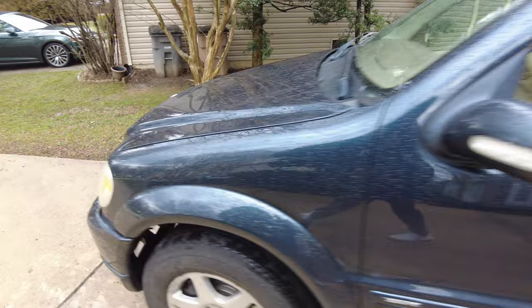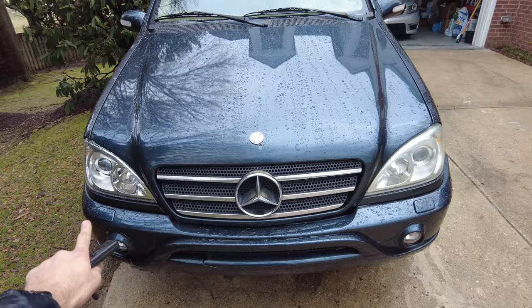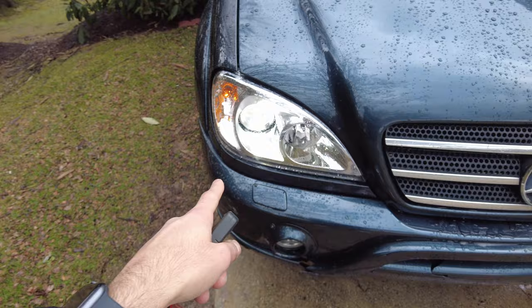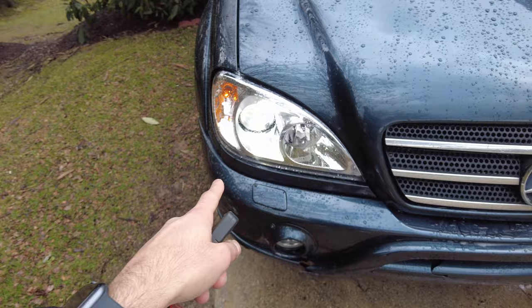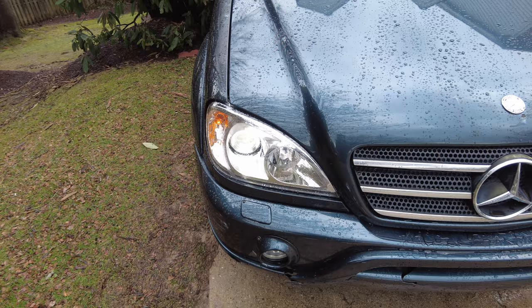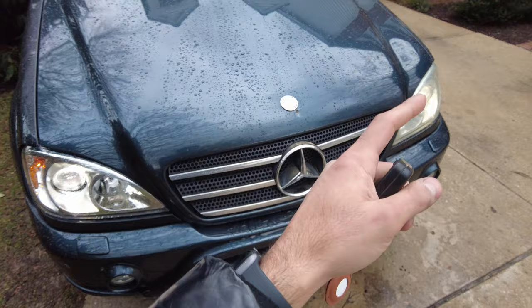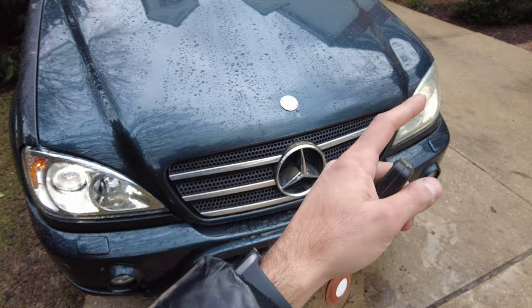I also went ahead and fixed that no headlight issue — you can tell this one is a lot newer looking than the other because it is. Both Xenons now work. What the issue was: I tested everything and couldn't find it. I replaced the Xenon bulb — it's a D2S bulb — with the Philips bulb from FCP Euro; that didn't fix it. I thought maybe it was the igniter, swapped the igniters — it wasn't that. Then I thought maybe it's the ballast, so I went to pull off the ballast but the Torx bolts were corroded — one head broke off and I stripped another bolt. So I couldn't do anything with that ballast.